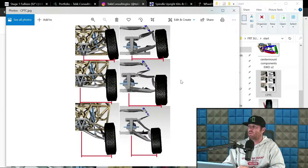And he did have his own specifications. Just like a lot of guys that we work with, especially the more experienced guys, they know what they want. So they're telling us, hey, I want this camber curve, this caster curve. I want these other characteristics, whether it's certain specifics with Ackerman, certain specifics with rake, consistent caster, things along those lines. So on the left-hand side, that's a T4.